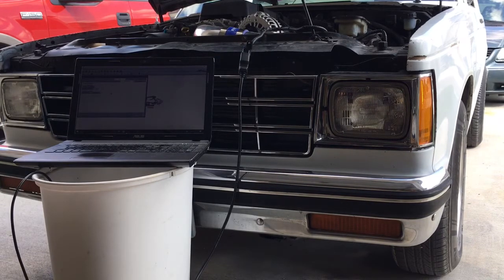I want to increase my power between 2,000 and 4,000 RPMs. Because as it stands right now, with the current tune that I have, it's just lazy between 2,000 to 4,000, and then has a noticeable kick or increase in power once you reach about 4,000 RPMs on up to the red line where you shift.